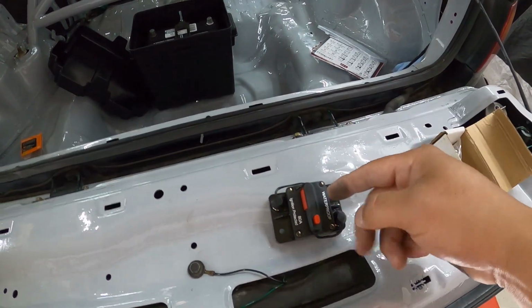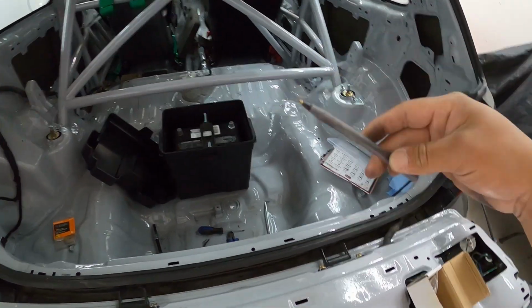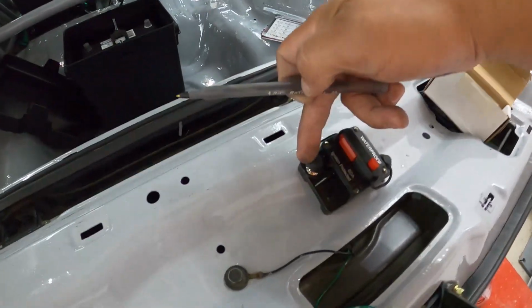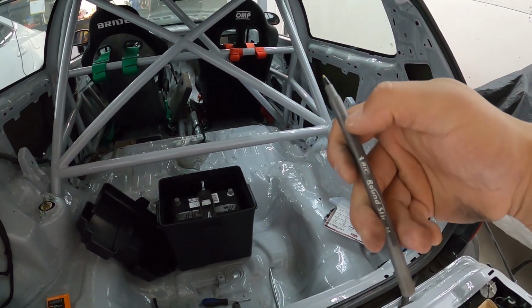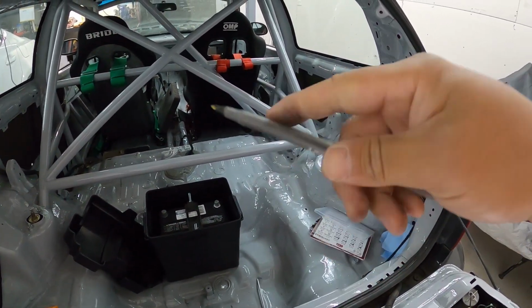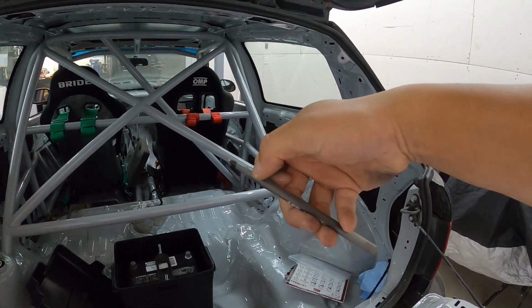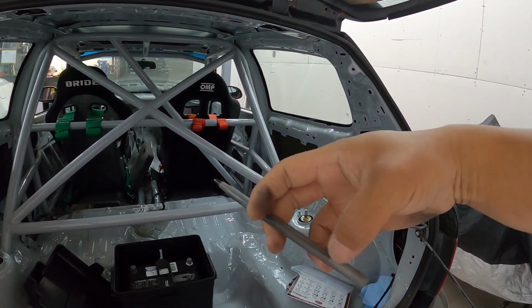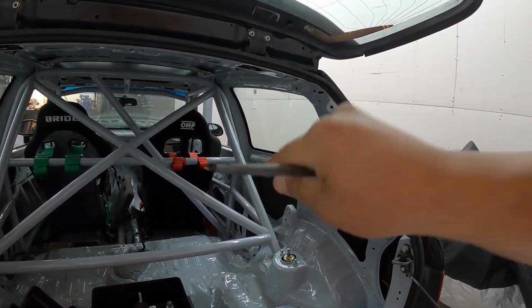It's got a bimetallic strip inside, so if you were to look at this pen here, this is the strip that's making the connection from this post to this post here. It's a bimetallic strip, meaning it's made out of 2 different materials, so it's going to have 2 different expansion rates. If you're looking at a pen, this would be split along the long side of the pen itself, so it would have a material on top and a different material on bottom.